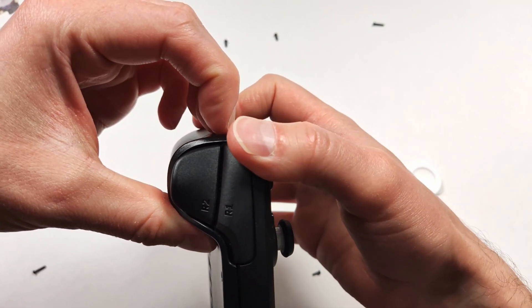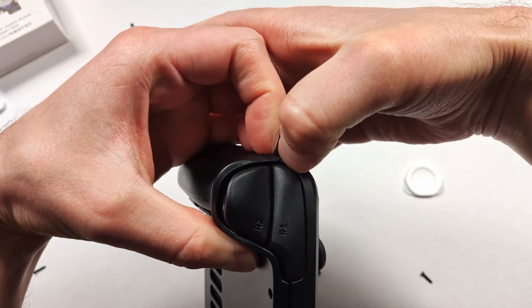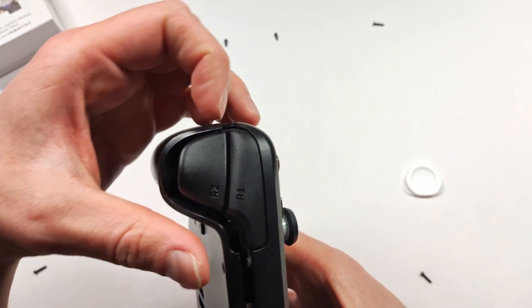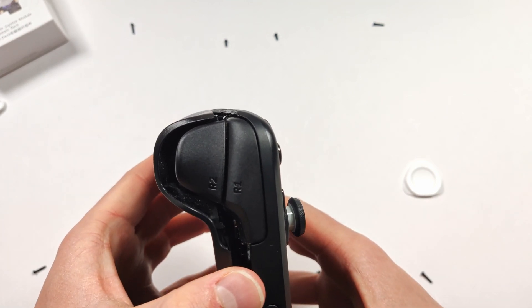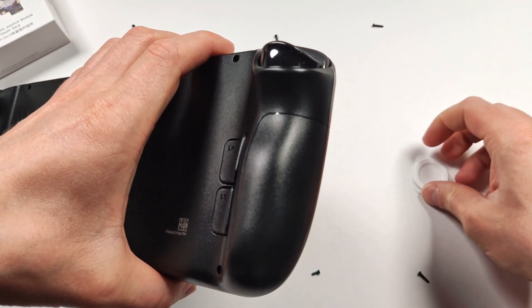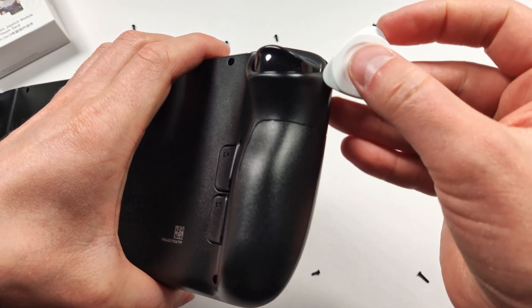Generally, what I find works really well is to just start behind this trigger here, because you don't want to start from one of the seams — that's a good way to nick the edge of the device. It looks like most of the top came open here, but the side is still kind of stuck. Let me try the other side. With the top part open, I just kind of stuck my fingernail here and just pulled, and it seemed to open a little bit. Now that I know those edges open up pretty easy, I'm going to take the little pry tool and try to open it up.